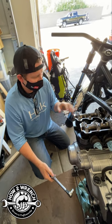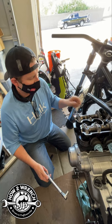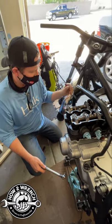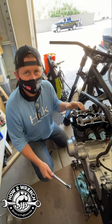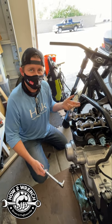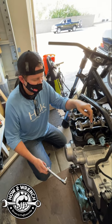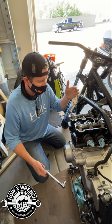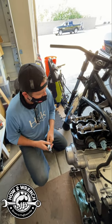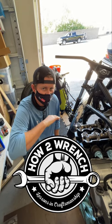For our YouTube fans right now, the takeaway is: stuff happens, bolts still break, but if it's a small torque fastener like this — especially a well-lubed one — don't start jumping into drills and taps and dies. Think of little screwdrivers or picks to walk it out. Another common place on Japanese motorcycles is the clutch basket bolts under the springs — people way over-torque those and break them. Same six-by-one thread; you can usually walk those out too. Do not attempt to reuse a bolt — make them new, and it has to be OEM. You're not going to a hardware store for this bolt. Jeff, it was fun seeing your project in person. Subscribe, like, share, and keep wrenching.